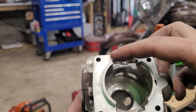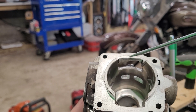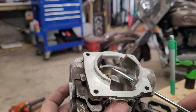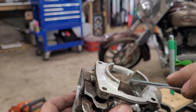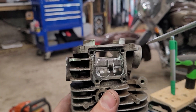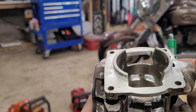With the lowers, all I did was open up this wall a little further — not much, just a little bit — and rolled it over nice and smooth. Here's your intake, and I also smoothed out this side; it had a nice hard line right there and I smoothed it out to a soft line. I got them as flat as I could across the top — they look rounded but on the inside where it matters they're nice and flat.